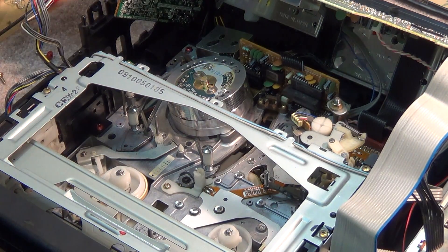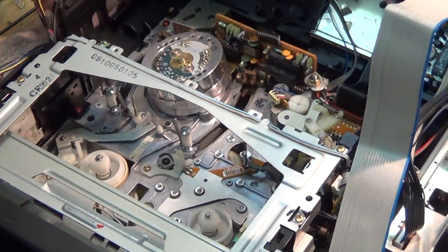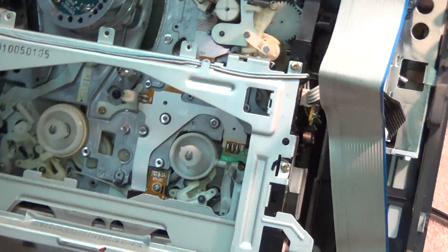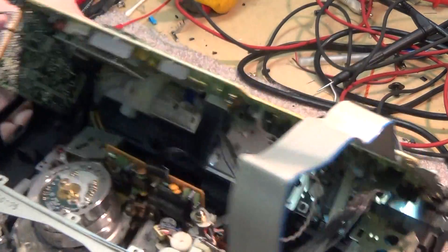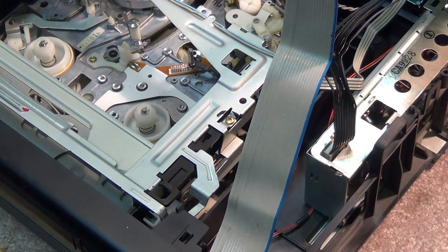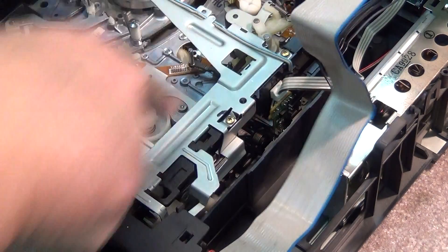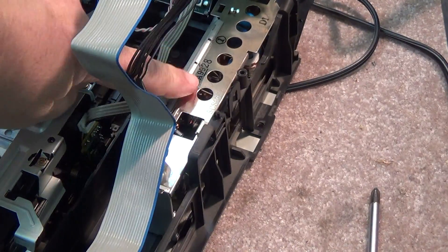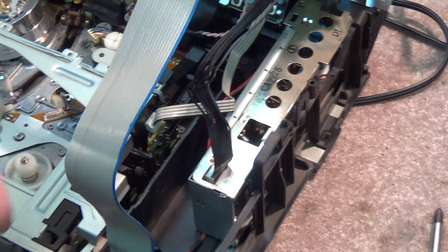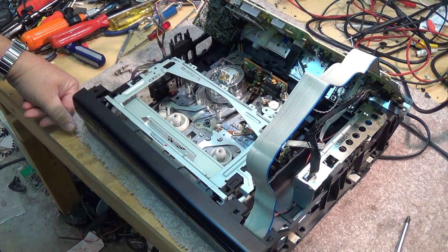They wanted to differentiate themselves from the all-plastic mechanisms coming out from manufacturers such as Sony and JVC. These machines are actually quite well laid out and relatively easy to work on. There are some very common problems: the mode encoder switch back here is notorious for getting dirty — that's this rotary encoder switch. There is also a linear encoder switch down here in the front loading mechanism that determines whether the cassette is in or out. And there are a lot of power supply issues with filter capacitors that go bad. Being a switching power supply, we have to take our isolation seriously and use an isolation transformer.